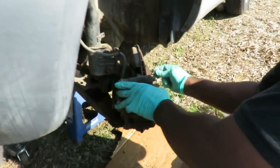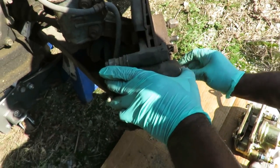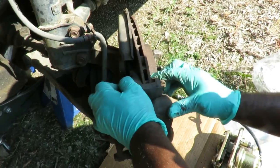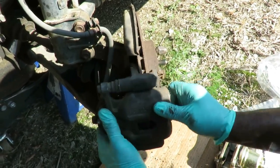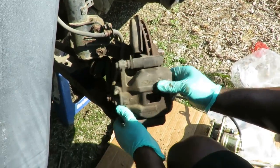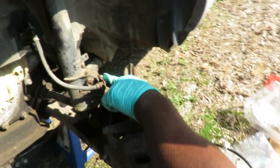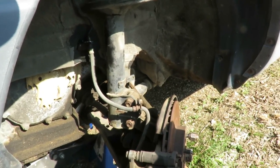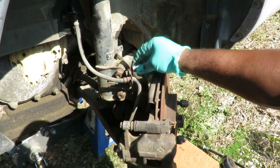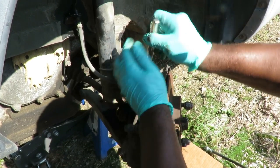Yeah. So I'm gonna put two of the lugs back on. There's some thin rotors. Yeah, they are. And then sit here and what? I'm gonna get a screwdriver. But before I get a screwdriver, what I'm gonna do is take off this bolt up here to take off the rest of that line. That'll look like a 12 millimeter also. So let's go over here and see. Yes, it is. So I got my 12 millimeter 3/8 drive socket with my 3/8 drive ratchet.